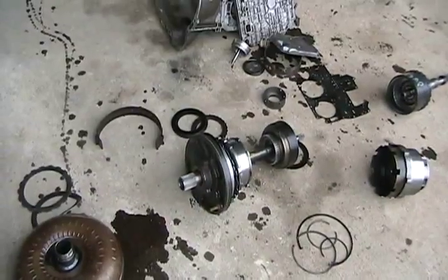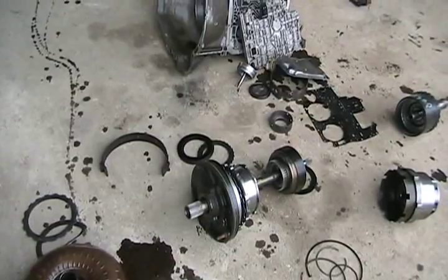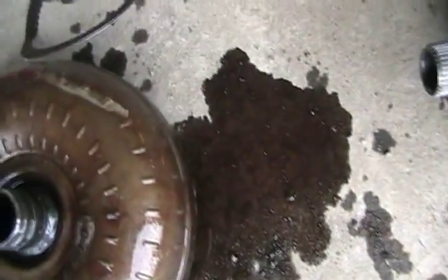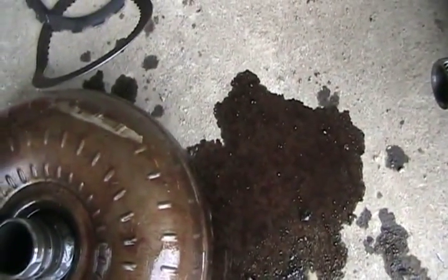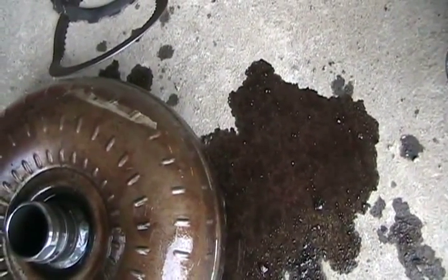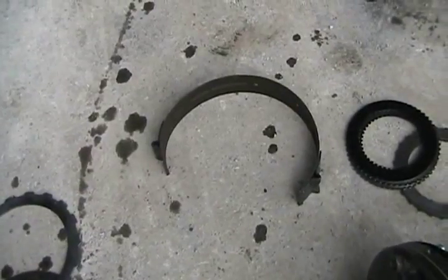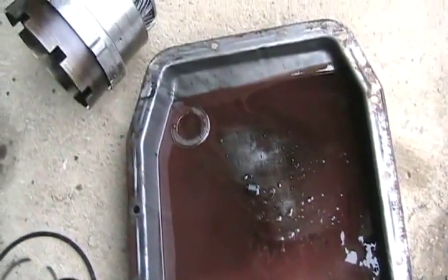If you're accelerating with your automatic transmission car, stepping on the gas, and the engine's revving up but the car is slipping — the transmission's slipping, not going as fast as you're accelerating — then some of these clutch plates are worn out, or these brake bands. When they wear out, they discolor your fluid so it looks brownish. All that friction material ends up in the oil and makes it cloudy. A good, healthy transmission has bright red, clear oil and doesn't have a burnt smell. When those clutches or brake bands are slipping, they always leave a burnt smell. As you can see here, it's pretty murky — exactly what you don't want to see in an automatic transmission.